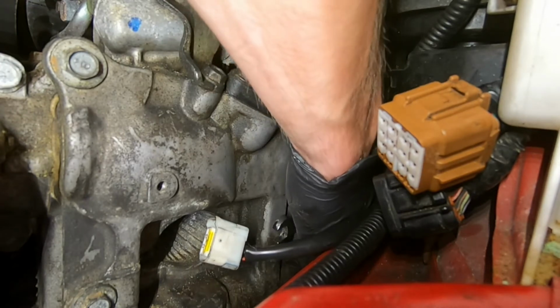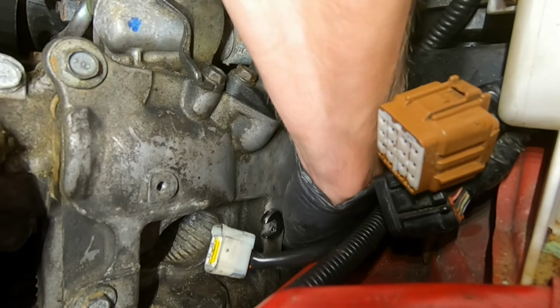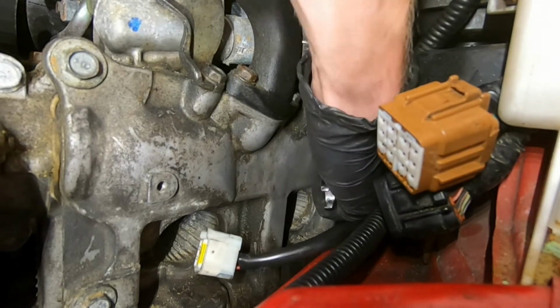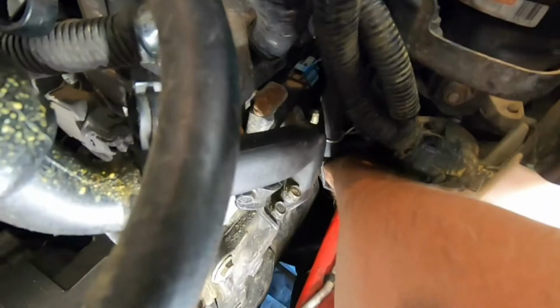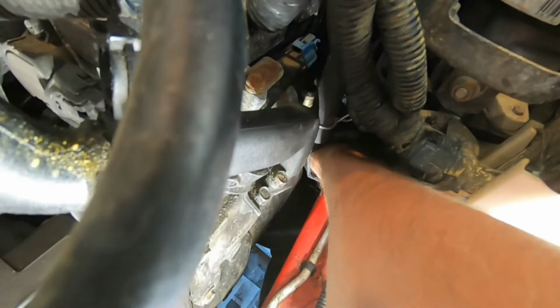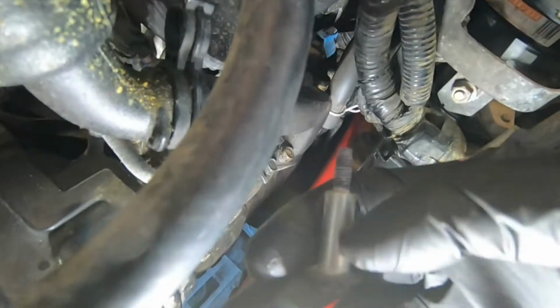So just put our gear wrench back there, find the bolt. All right, so just because the access is easier doesn't necessarily mean it's easy. So again, you may have to wrench on that thing for a while. So a 10 millimeter flex head gear wrench is gonna be your friend. But then once you can get to the point where you can unthread it by hand, she'll pop out.